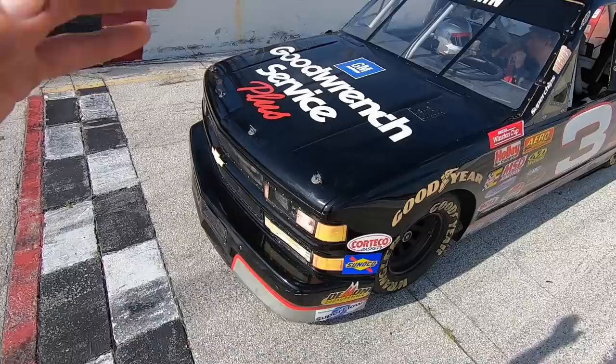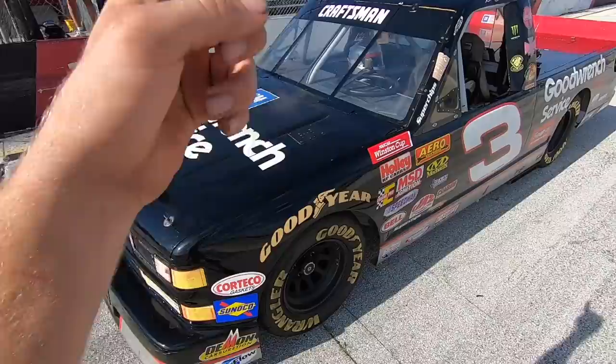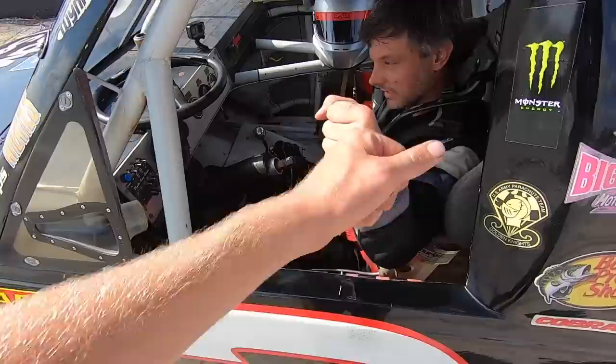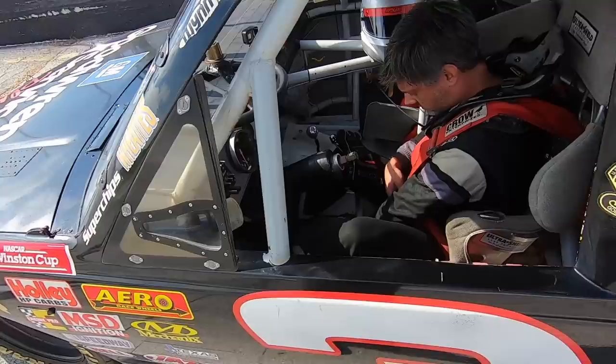Here's the deal — I can only go a couple laps before it started to oil starve, and not like drop to zero oil pressure. We're talking like the low thirties, and then right when you dive into the corner you could see it start to fall towards 20. The warning light that Kevin set up did its job first time around. Now we know — we have a drag racing oil pan on here, but that's no big deal because there's plenty of clearance on this cross member. So what we'll do is get a road race oil pan for it, slap it on there, and shouldn't be a problem from there forward.